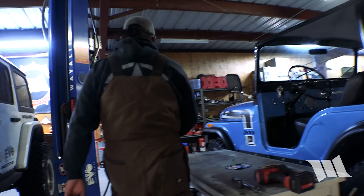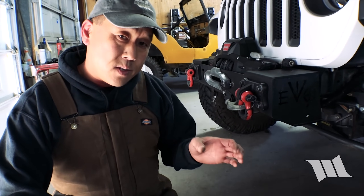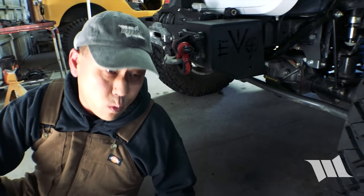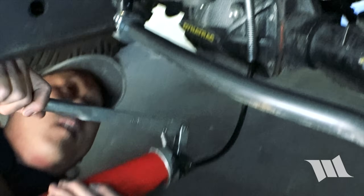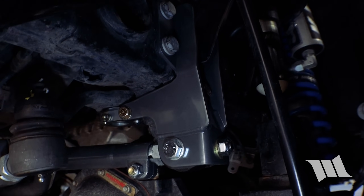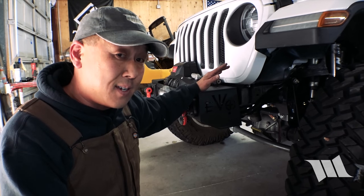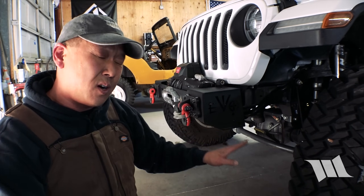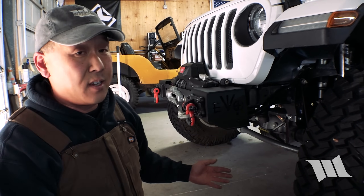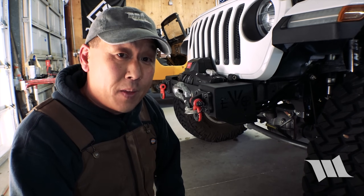One last thing — greasing. The final step is to apply a little bit of grease to the Zerk nipple that we installed on the sector shaft brace. There is an oilite bronze bushing installed in it, so it doesn't require a whole lot. We're just going to hook up our grease gun and give it a quick little squirt. And there you have it. We now have a reinforced, beefy track bar bracket installed on our Jeep JL Wrangler. If there was any deflection on our Jeep, it won't be there anymore. Ever since we installed the Synergy tie rod, drag link, and track bar, our JL has been running rock solid — but this bracket and sector shaft brace will only make it that much better. Highly recommend it.